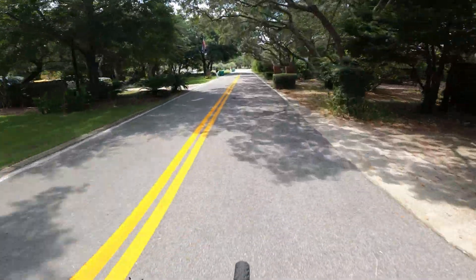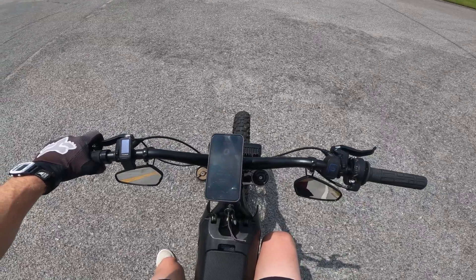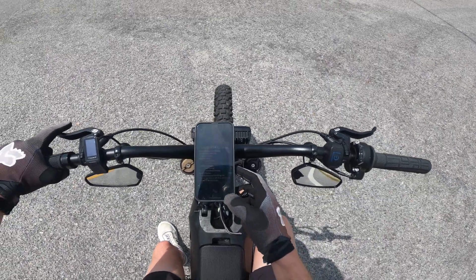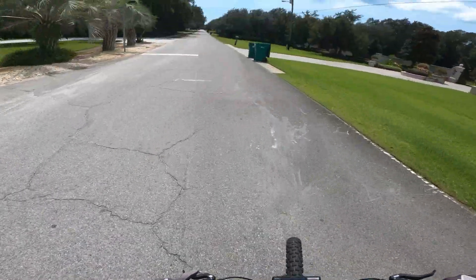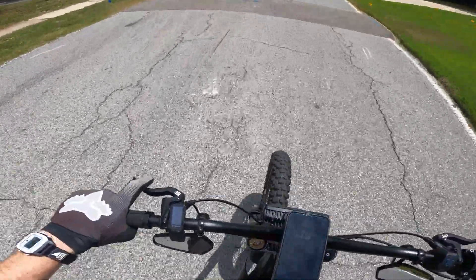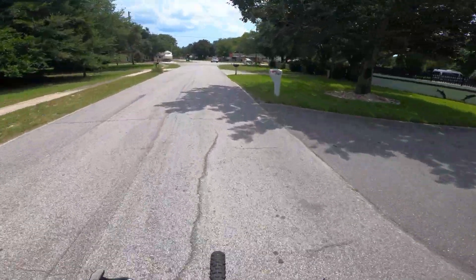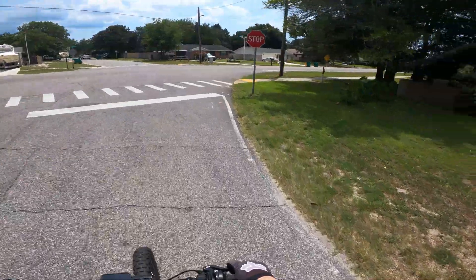I'm not going to bump it up to 50 amps because I don't want to mess up my battery or damage my motor, so we're going to drop it back down to 20 amps of field weakening and have a little fun doing some wheelies. After those few pulls we've already dropped to 84 percent at 60 volts — nearly 20 percent in not even 30 minutes of riding. We're now at 83 percent; field weakening will easily juice your battery, so use it sparingly and don't become stranded.